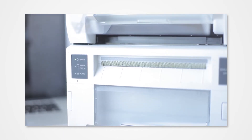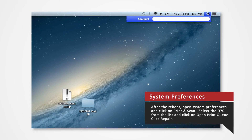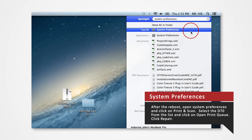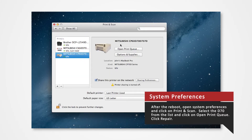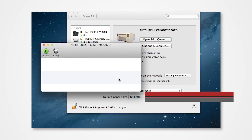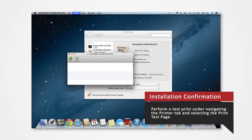At this step, power on the D707 and connect the USB to the Mac. In the Spotlight search, type System Preferences and click on System Preferences from the drop-down menu. Select Print and Scan from the System Preferences. Select the installed printer in the printer list and click the Open Print Queue button. Click the Repair button to set the access privilege for the printer driver.